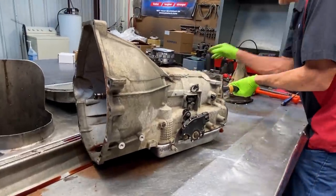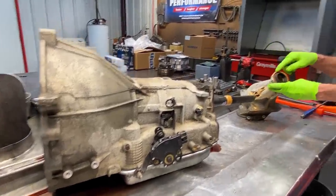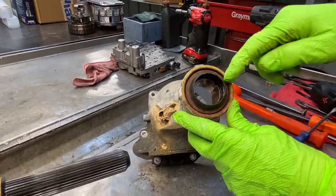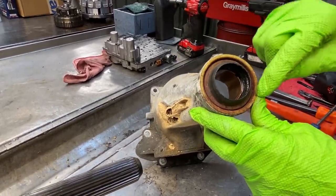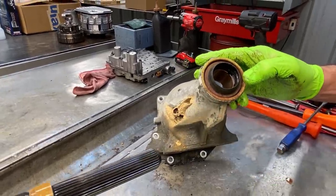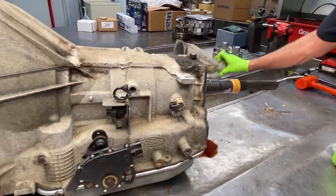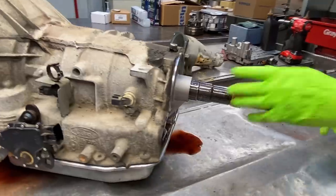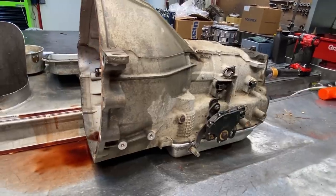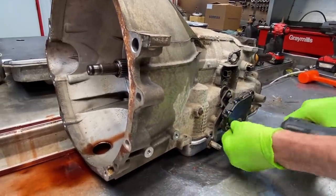On the AOD transmission — the early AOD and early AODE had a smaller bushing and seal. When they went to the 4R70W and 4R75, they put a bigger seal and bigger bushing here. You can tell this seal here is a yellow color, that's how you identify it. The other one will be a red seal. The 350 seal is basically the same thing — 4L60E stuff uses the same seal. We have no governor back here, no check ball for it, no snap ring groove. We also have our output speed sensor.